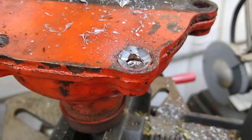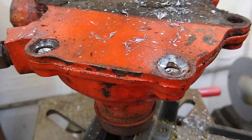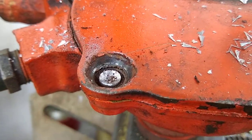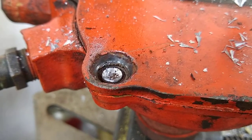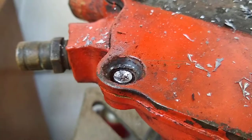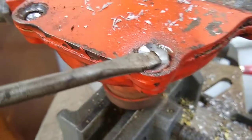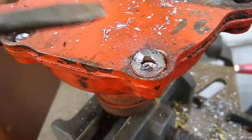I ordered a rebuild kit that comes with new bolts, so I had to drill the old ones out. Here you can see I drilled down — I used pretty good size drills, working up to a 9/16th, which was the last one I used. That really was able to get in there and scoop out the head, and now they're coming off. I pried them off.